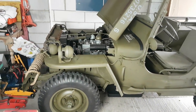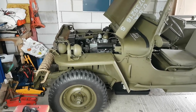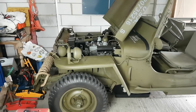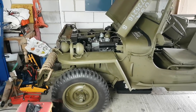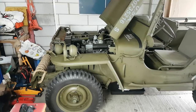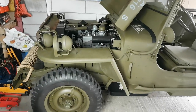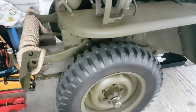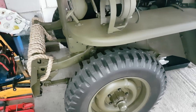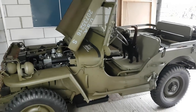We've just been out for a quick run to test everything out and yeah, it all seems good. The Jeep's running really nicely. I readjusted my timing — I was getting some ticking noises which I thought were the adjusters on the tappets, and I did work on those while the side was off, but it wasn't the tappet adjusters. The timing was retarded which was causing a bit of a ticking noise — not pinging or detonation. It seems to be some sort of valve interaction, but anyway it's running much better now. The fenders are all on, the fix is complete — you can't really see it from a distance unless you're looking closely. I'm pretty pleased with that.